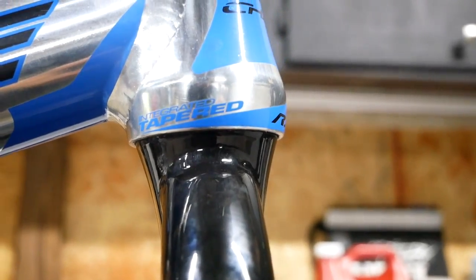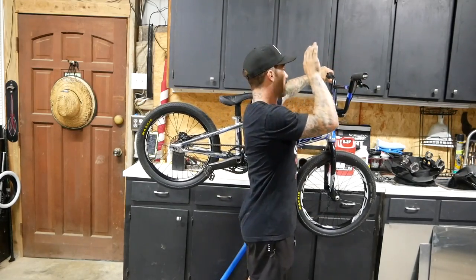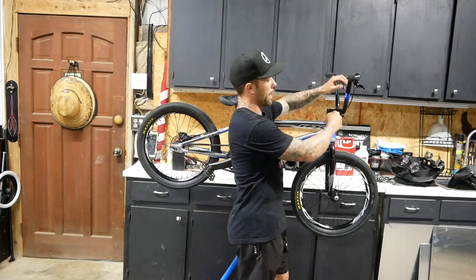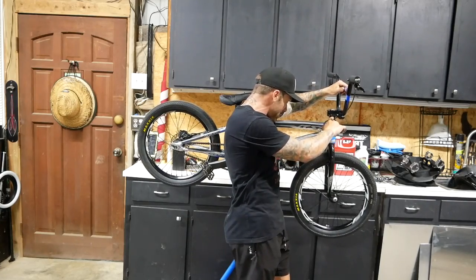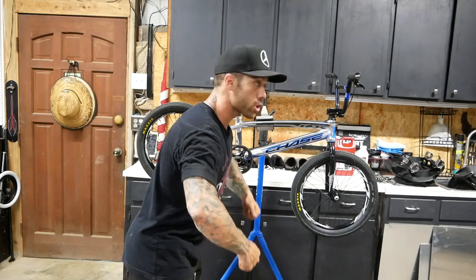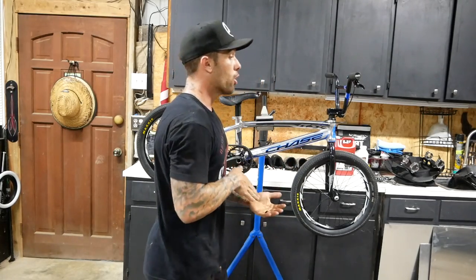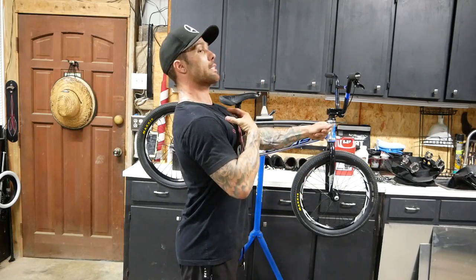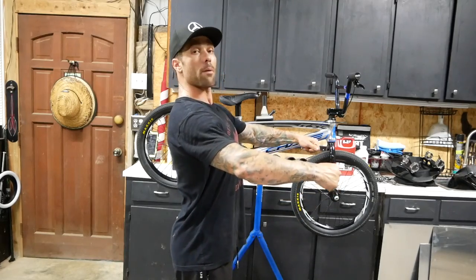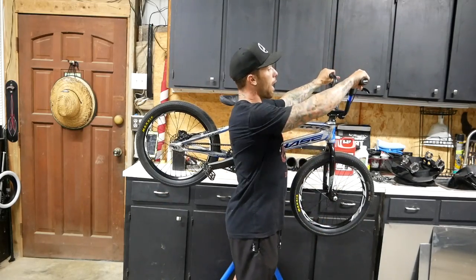The race frame has the tapered head tube. Elevn provides a chromoly tapered steer tube fork so that all buttered up just perfect. Handlebars - these are the exact 8 inch rise Elevn bars, same bend and everything as my race bike. I run a drop stem on my race bike so I want my front end lower with no spacers. It's almost 3 quarters so it actually brings my bars up to more of an 8 and 3 quarters rise. In racing you want your handlebars low because you want your weight over the front, everything in an aggressive attack mode. But in dirt jumping or skate parks you want to stand up a little taller - that's why they have tall handlebars. So bars are a little higher but they're the same bend.